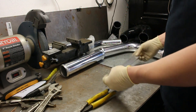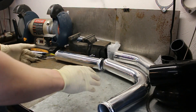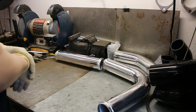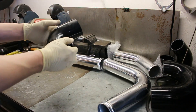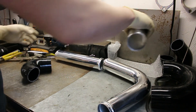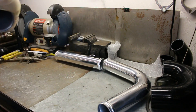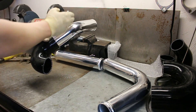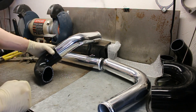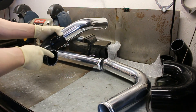That is pretty much how you make all the pieces for the kit. Now, how does this all go together? We're going to picture that the intercooler is here — this is going to be the passenger side and this is going to be the driver's side. On the passenger side, you're going to have your 135 degree coupler coming out of the intercooler. Your 45 degree pipe goes into that 135 degree coupler, facing at an angle. That's all there is on the passenger side — this goes into your factory intercooler piping up top, and this goes onto your intercooler.